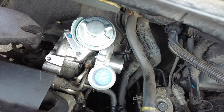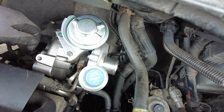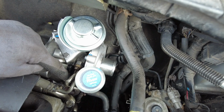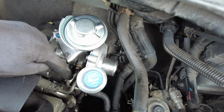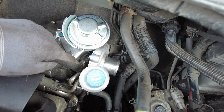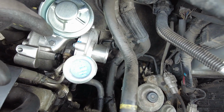So getting the turbo back into position is a bit of a tricky one. It's a 2-man job if you've got someone to give you a hand, because you kind of need to get the bottom pipes on first, so you kind of drop it on halfway into the bottom pipes like these ones here, and then you slot this front one on next, and then you kind of drop it onto the nut at the front here, so it all then drops into place.